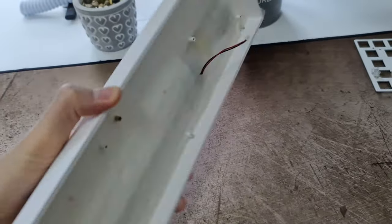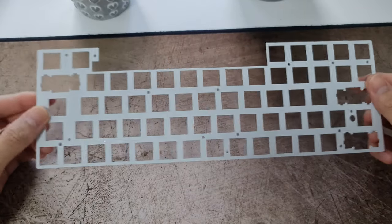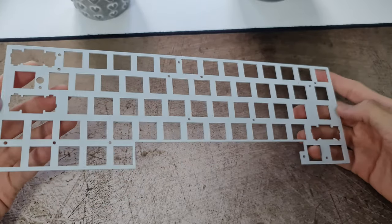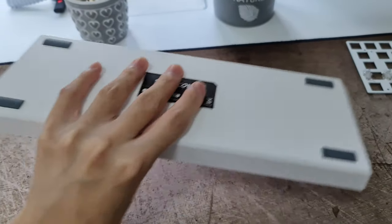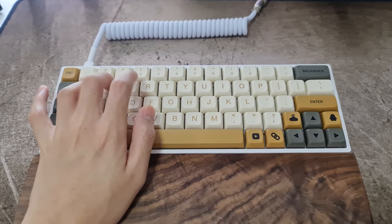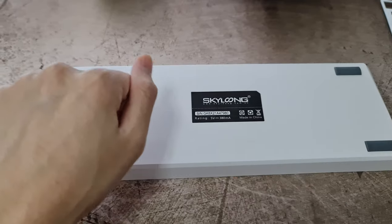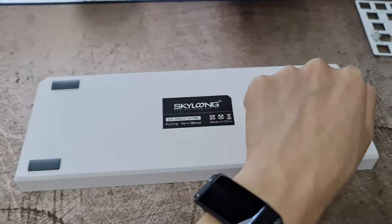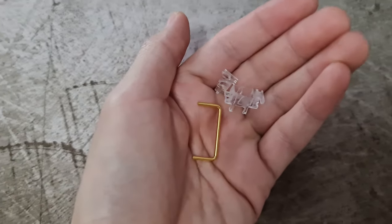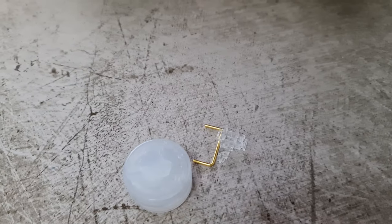This keyboard comes with a plastic case and a steel plate. The plate looks nice — it's white in color, which I prefer, and it looks quite durable. I was also thinking to upgrade my plastic case into an aluminium one, but I like the sound profile of a plastic case more. For its price, this keyboard is amazing. I changed my stabilizer to the Everglide Panda plate mount stabilizer version 3 to reduce the rattle. I lubed them with Krytox 205 Grade Zero and dielectric grease.